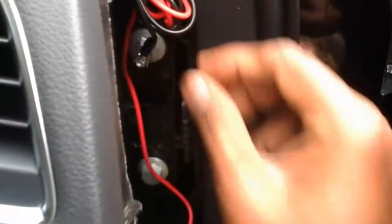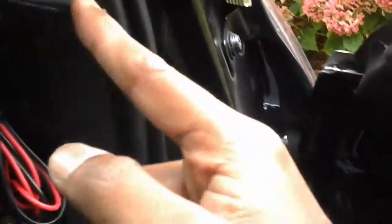For passing the wire through, I managed to push it in slowly with a screwdriver, putting it initially in the corner and running it through the hole of this section. I chucked it into this junction and managed to tuck it in here. It might feel tight in this area, but there's a little bit of space just on this corner so you can slowly bring it through to the other side for your dash cam.